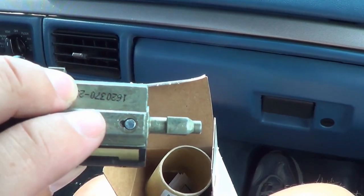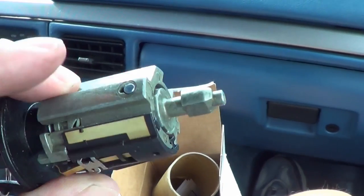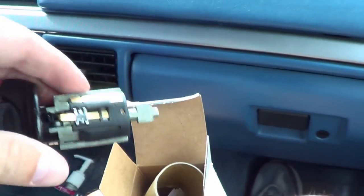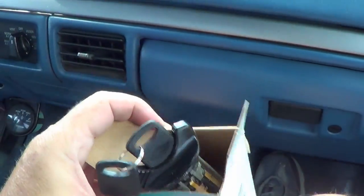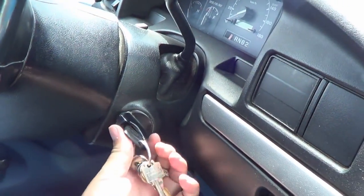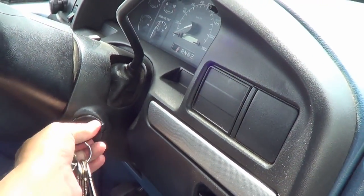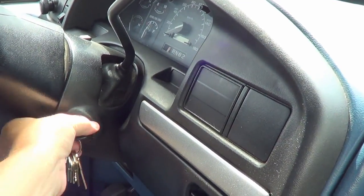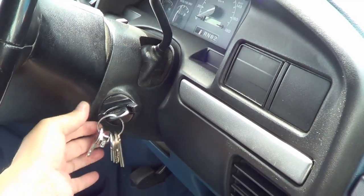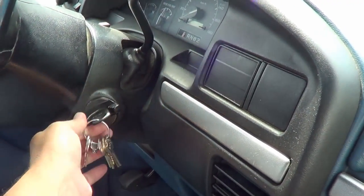You can see right there — that's the little pin, and it's depressed right now, so it slides in. Once it's in there and you turn the key, it pops out. What you have to do, reading the instructions, is you want to try to get this done before the key fails totally, because you want it in the run position so that you can depress that little pin and then the whole cylinder should slide out for replacement.